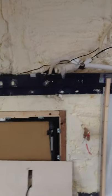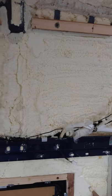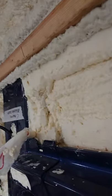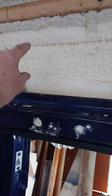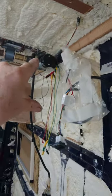The spray insulation. Now, a lot of people have said it bows your van or doesn't bow your van, one way or the other. Well, they're both right. It doesn't really, but it does a bit. You've got to be a bit careful how you spray it. You have to do it quickly, a thin layer with a wide nozzle, and then let that expand. And then if you need to, go over it again with a second layer.